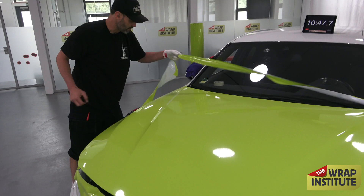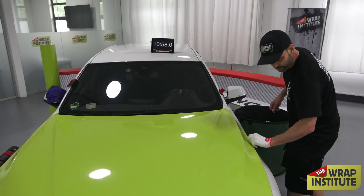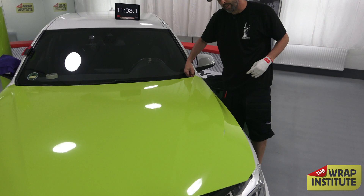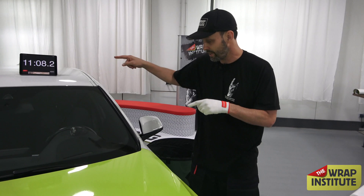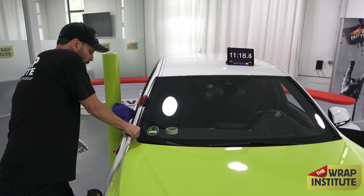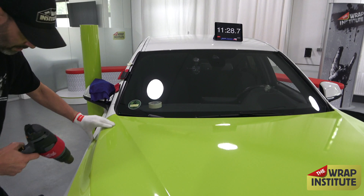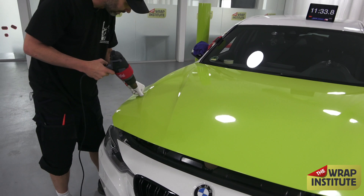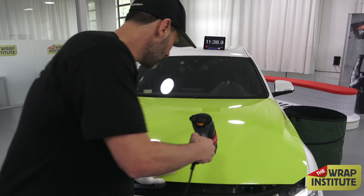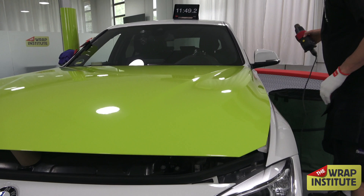Now that everything's done and cut out, I take all the excess material in one shot and put it immediately in the trash. The backing paper is in one spot on the floor, safely away from anyone tripping on it. I come back and seal the deal, pull away the masking tape, and for the most part the hood is done. But a good wrapper finishes strong — just because you cut everything out and squeegeed everything on doesn't mean you're done. Post right now is all about QC: making sure there's no bubbles, making sure it's wiped down. I take the heat gun and go around the edges and double check for bubbles. The heat makes any air underneath the film expand, so it shows any bubbles. If there are any loose edges, the heat will make them pop up.